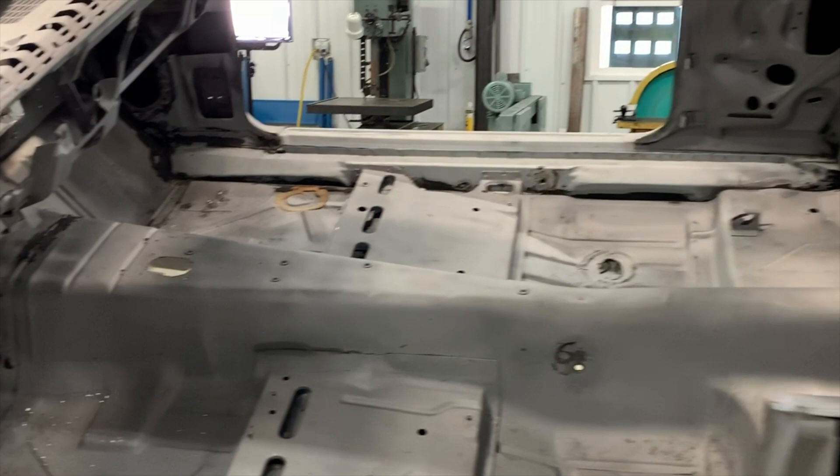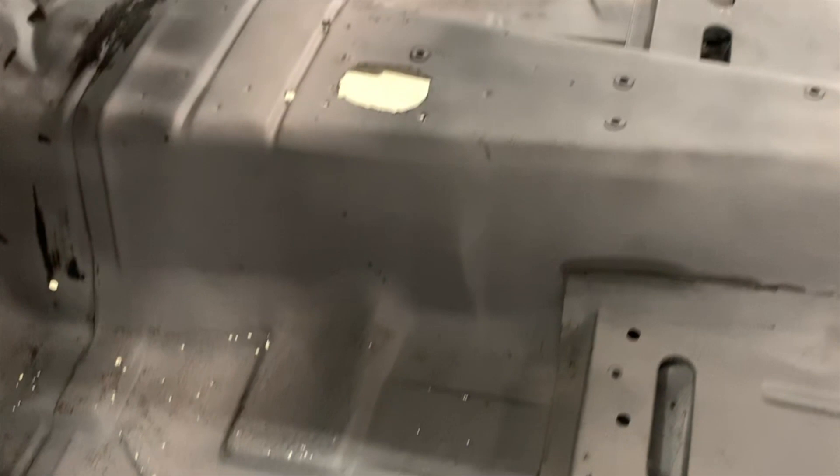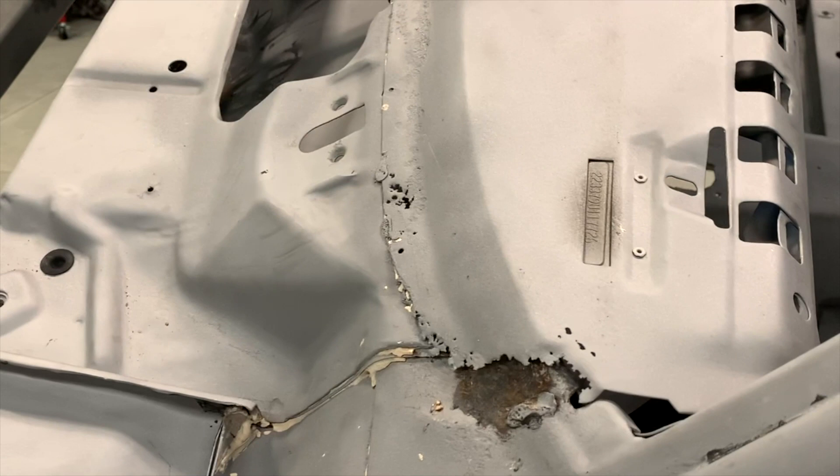Come with me and we're going to take a look at the car and see some of the areas that we have concern with. First, I need to address some of the floor pan — there's some perforation going on here, not really bad. A lot of these I'll be able to just drill and plug weld, and some of the areas I will have to cut out and replace with a patch. But in this area, this is pretty typical on this type of car.